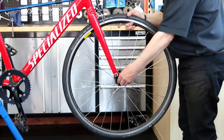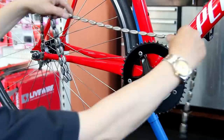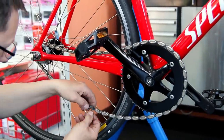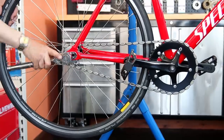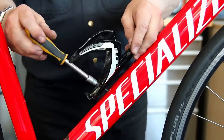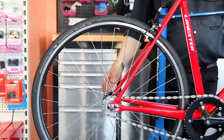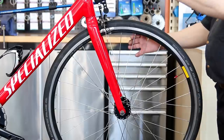Now we're getting the wheels on — front and rear looking absolutely beautiful. On goes that lovely chain; look at the way it comes up after the ultrasonic cleaner — it looks as good as the day it left the factory. I also lubricate the threads for any accessories on the bike because they're very prone to binding, especially stainless steel screwing into an aluminium rivnut. We check the brakes and everything's running smoothly.